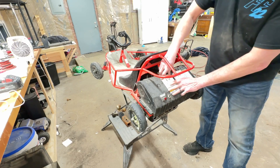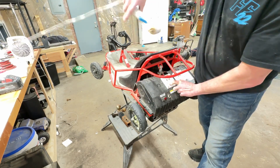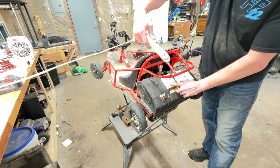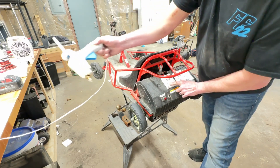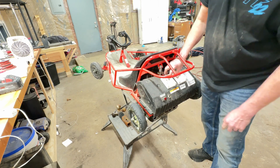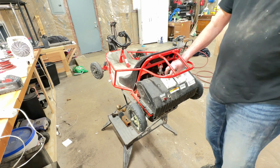Semi-pro tip: fire up a hot glue gun when you get something like this. I'll just put a couple dabs of hot glue and tack the holders into place, then go ahead and drill the pilot holes and drive the screws into the plastic to hold them in place. Let me get those in place and screwed down, then we can do the wiring quickly.